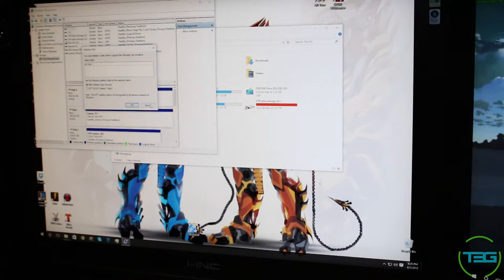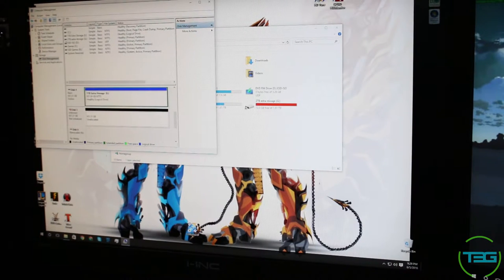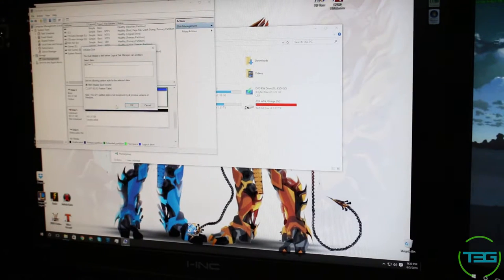There is a Disk 5 being registered. I don't know if initializing will erase my files so I'm going to hit Cancel for now. Scrolling down, on Disk 5 it does see a one terabyte hard drive — it says the actual hard drive is unallocated and not initialized. I'm going to right-click on the left where it says Disk 5 and hit Initialize Disk. It might be a problem where that circuit board messed something up and the data is gone, but at least the hard drive itself still looks good. Unfortunately for my wife, that data may now be gone — but this doesn't always happen; the last one I was able to save all her data.